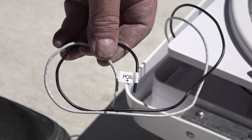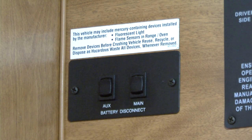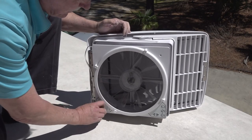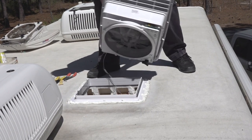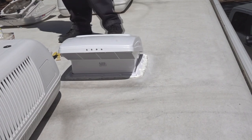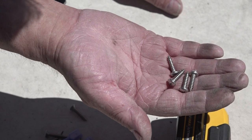For our installation we need a 12 volt DC power source for the ventilation fan. The existing wiring used for the old fan will work perfectly. Turn off any 12 volt disconnect switches or disconnect the negative battery cable from the battery prior to making electrical connections. The fan must be open prior to making the wiring connections. With the fan open and the louvers facing the rear of the vehicle, lower the fan onto the roof receiving flange. Make sure the wires slide to the interior and don't get tangled or caught on anything. Make sure the fan is seated and fastened to the flange using the four three-quarter inch stainless steel screws.